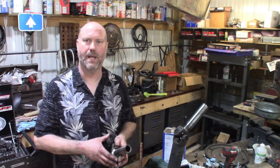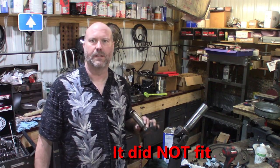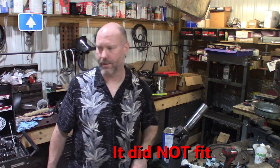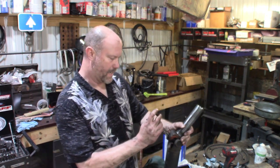If nothing else, I'm gonna go get a bastard U-joint, to be honest with you, because I wanna save $80 by not having to buy a new yoke. So let's get this old yoke off, and then I'll tell you whether or not it fits this one or not. With my luck, it's not going to. And the reason I'm not changing the U-joint is this U-joint is in great condition. There's no slop in it. So I don't want to buy a new U-joint if I don't have to. But if I do, I do.